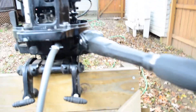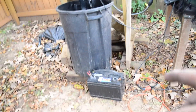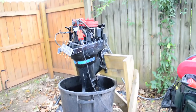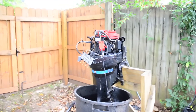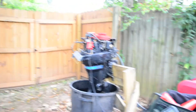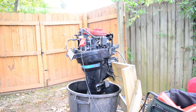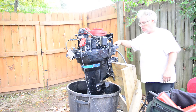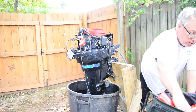Unfortunately I can't film this well because of the setup. Over here I've got my spark grounding tool, a battery, my timing light, and my drill. Spark plugs are out so I can turn it over with the drill. I'll have to shoot with one hand while turning the flywheel with the other. I squirted a little WD-40 in the holes. Now I'm set up and I should be able to put it at start and check where we are with the timing light.